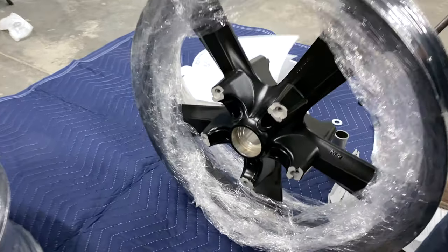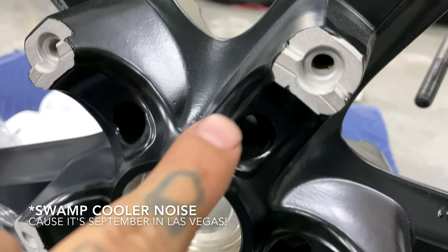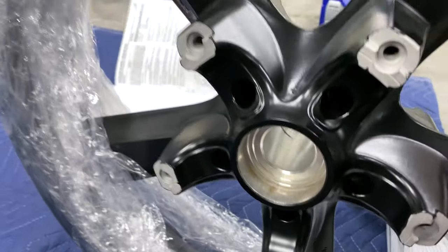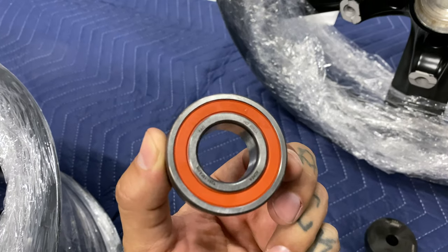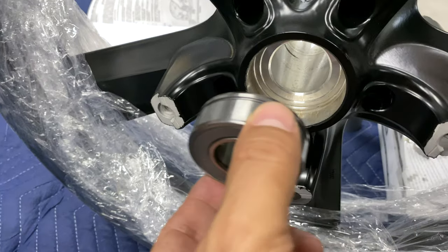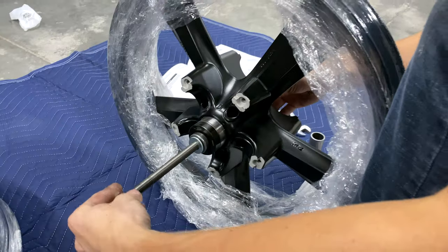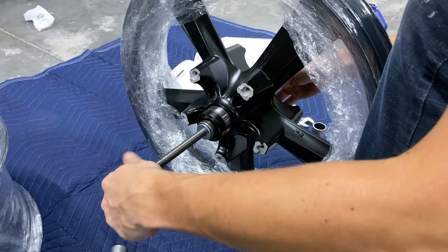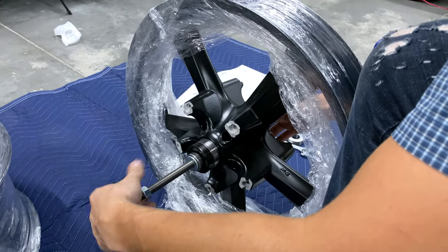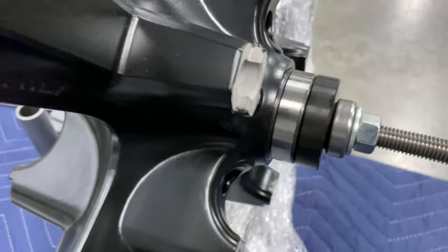All right, you guys, so when you're installing these bearings, you're gonna wanna find the primary side. We'll have these little grooves right here. And that's when this bearing comes into play. This is the ABS sensor bearing. This orange part is going to go inside, facing like that. We're using the Jim's bearing installing and extracting tool. We'll have the part number for it on the link below. Make sure everything's aligned.